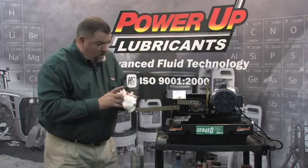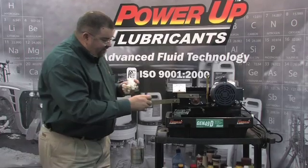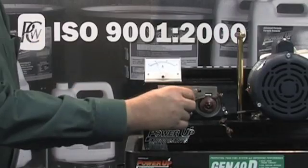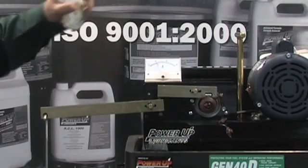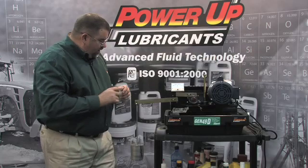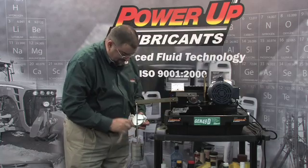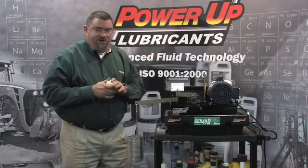There are two reasons that I do it this way. One is to show you the compatibility of Thixo Grease. Basically all we've done is added the Thixo Grease into the center — I've left the red grease and coated it on the inside of that race, so when we get this thing hot we're going to demonstrate the drip point. We're running quiet and smooth. After we add the Thixo Grease we're also going to add some more weight — I'm actually going to double the load.